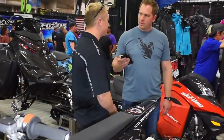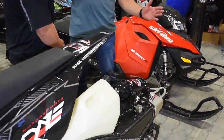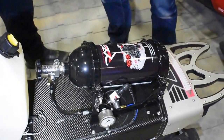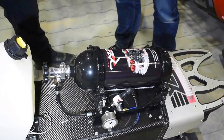100% — we actually patented the technology. I love the fact that you're getting up to that 10,000 RPM range and then letting the bike do its own thing on just fuel. Correct. And then as it falls down and loses power, you're boosting it back up — it will taper back in and bring it back up. But the best thing to do is just shift and let the nitrous pull it through another gear.